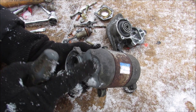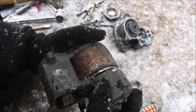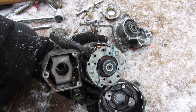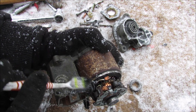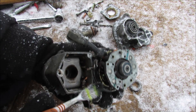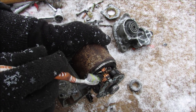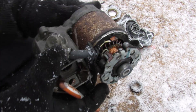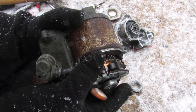What's left with the starter motor is just the electric motor part itself. I'm going to remove these two Phillips screws on the back. If I remove the casing here you can see we've got a bearing on the inside that rides up on the outside of this casing. Over here we've got the 12-volt line that comes from the solenoid — that's going to power this ring on the outside, and that's going to power this brush over here as well as this brush on the opposite side. On the two quarter sides we've got two other brushes that get grounded out to the case itself. Your brushes here are right up against the armature which turns with the electric motor.